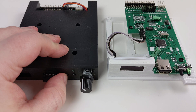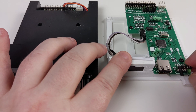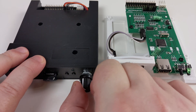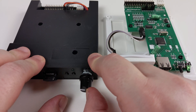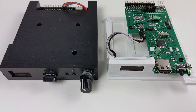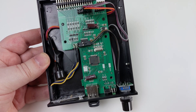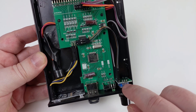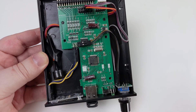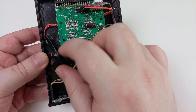Next will be some kind of input control - this can be two buttons and/or a pushable rotary dial. The Zaxon uses a dial, my Amiga one uses two buttons, and my general Gotek uses both. The buttons can be fiddly to use and it can take a while to navigate when installed inside a computer. The rotary dial is much faster. The great thing is you can easily mod a Gotek yourself to add the rotary dial if yours doesn't have one - it's literally the dial and some wires costing a few pence, connected to the respective jumpers on the board.